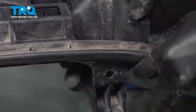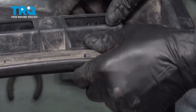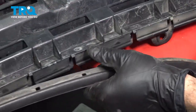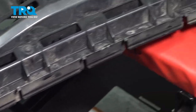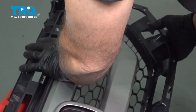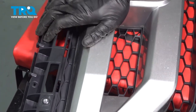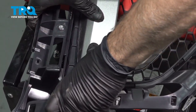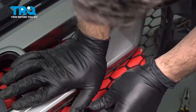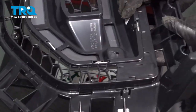I'm going to remove our hood-to-grille gasket seal right here, basically just peeling it up off of these little lock tabs. Take your insert here, line this up, and we're simply going to apply pressure as we go around and it should snap into place. Flip this over — you can check on the back side and make sure all of your little tabs are locked in.